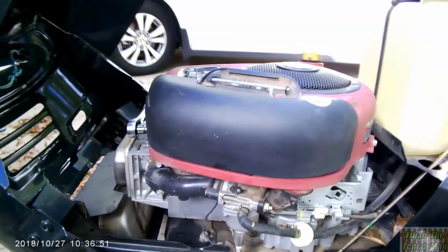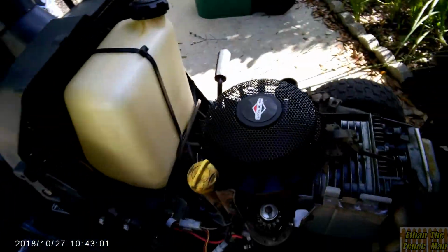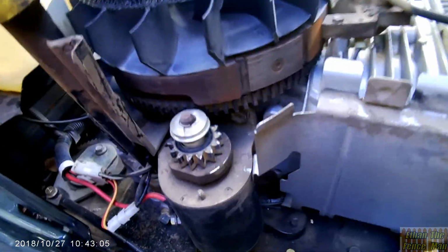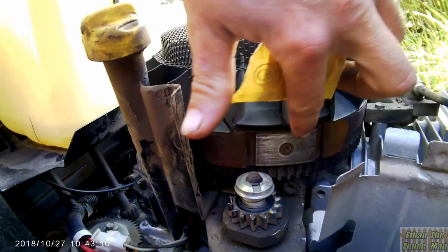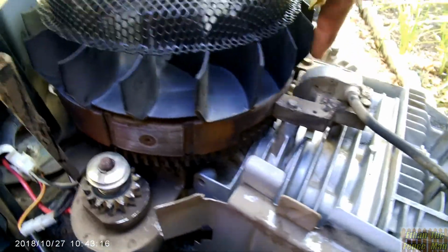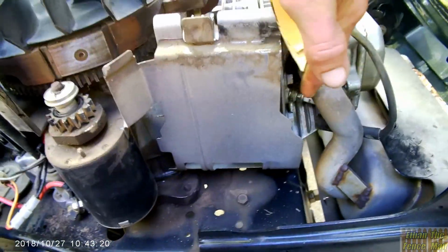First thing I'll do here is we'll pull these bolts and get that cover off and see how rusty the magneto is. It's over here in close. Sorry, I should have shown you that before I started sanding on it, but see, that is our magneto's magnet. This guy passes by these points real quickly and it generates electricity through magic and pixies, and then that electricity comes through that wire to your spark plug.